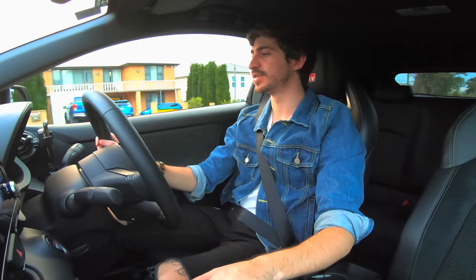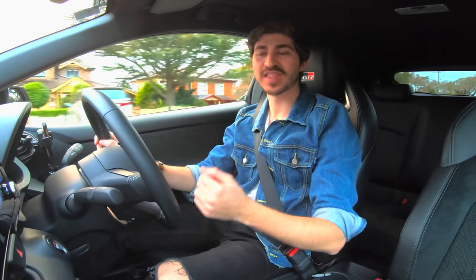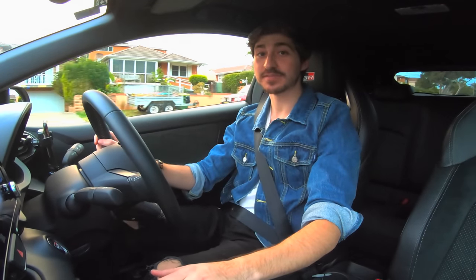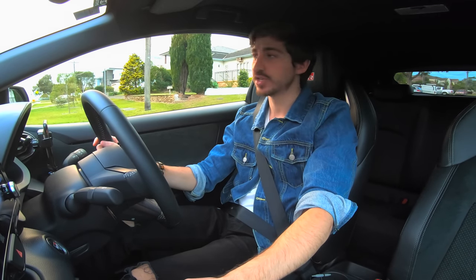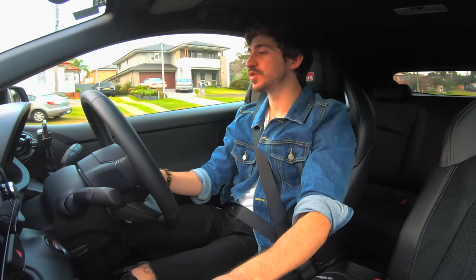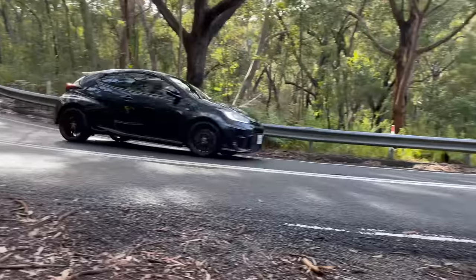Let's talk about the drivetrain. This is the first all-wheel drive system Toyota has made in over 20 years. Unlike other hot hatches that are biased toward the front and kick in rear drive only when needed, this is purely all-wheel drive all the time. In normal mode it puts 60% to the front and 40% to the rear. Sport mode puts 70% to the rear and 30% to the front. Track mode is a perfect 50/50 split. That gives you completely different options — sport for windy roads, track mode for the circuit. The result is 0-100 in 5.2 seconds, though many people are recording much quicker — even fours — on a stock GR Yaris.